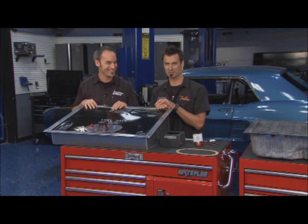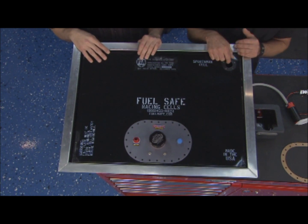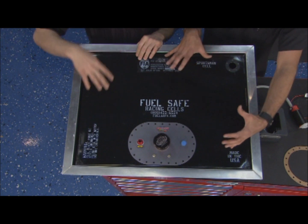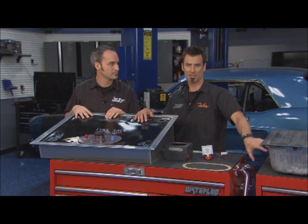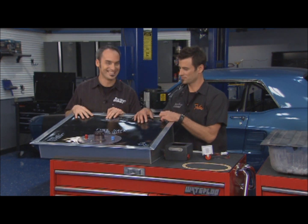But we're going to push this thing. We're going to go left hard, right hard, forward hard, and we're going to be in some dangerous situations — racing. So what we're going to do is switch over to a fuel cell. The big difference with a fuel cell is it has a bladder. If you get a side impact or any kind of impact, in the old days it would just shear the metal, pour gas everywhere, and catch on fire. Not a fun situation.